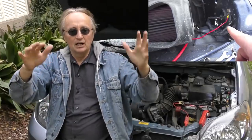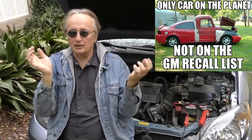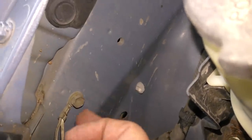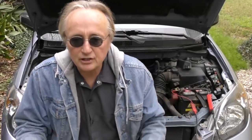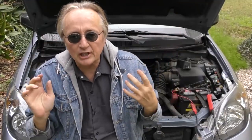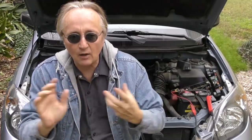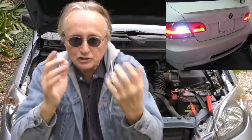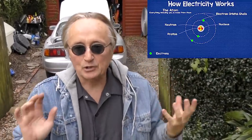The last gremlin that can knock out your car is bad grounds on the wiring system. This is a big issue in older cars, and GM in particular has a history of bad grounding problems throughout their lineup. Grounds are all over the car — here's the lighting ground on this Toyota, and it's getting rusty. Bad ground circuits cause the strangest things: the car may use power circuits to try to ground devices, causing horns to beep on their own, the radio to change channels by itself, or backup lights to stay on after you turn the car off.